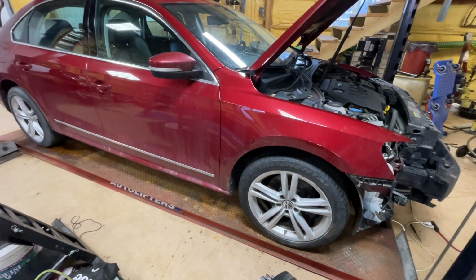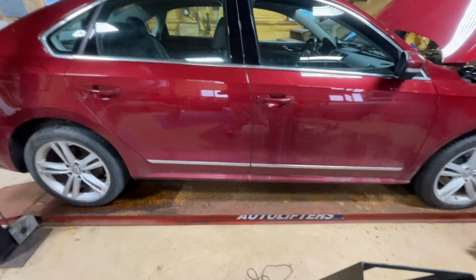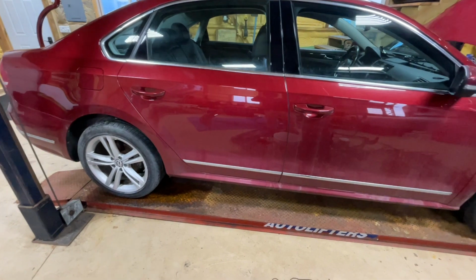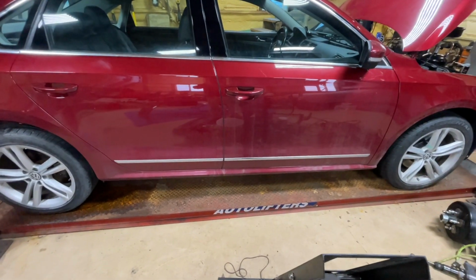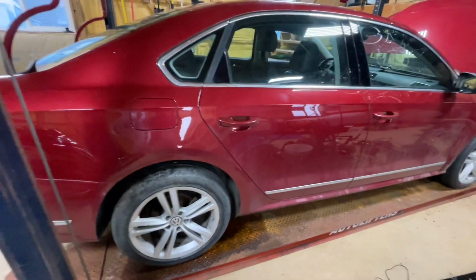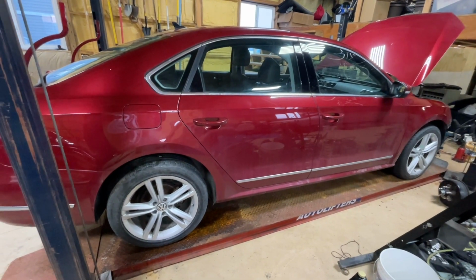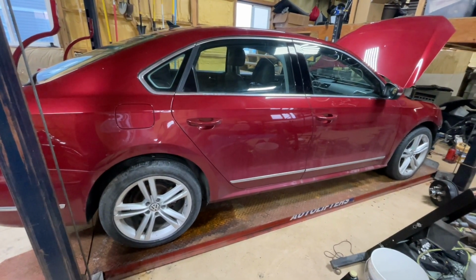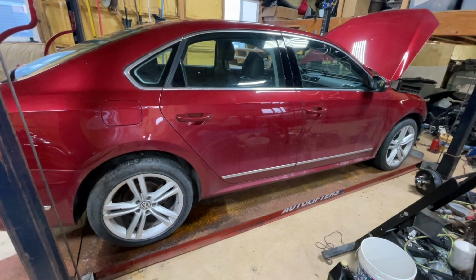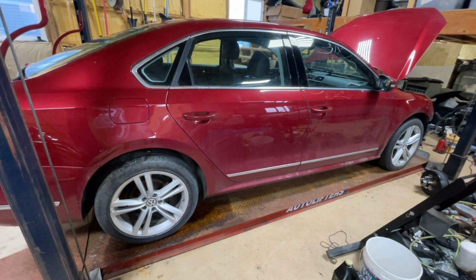But this one has a rise of, I don't know exactly what it is actually. I don't usually go all the way up because it becomes higher than is convenient to work on things. So it goes plenty high anyways, and I've got a 12-foot ceiling clearance in here, so it works out well. And like I said, it's great for changing oil, or if I'm gonna do a transmission job in a rear wheel drive like a truck or something, then this is the lift I use because I've got a nice big transmission jack, and that makes quick work out of it. So it's more the height that makes it good for transmission jobs than the fact that it's a 4-post. It's just in comparison to my mid-rise 2-post, I get higher lift out of this and can use things like my full-on transmission jack. Let's see, I think that pretty well covers everything.